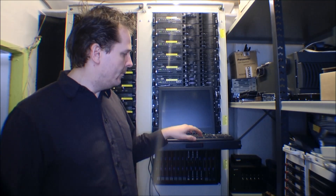Right now I am booting the server and I hit F1 to go into the BIOS. I hope I can find the setting I need to enable. Here we are inside the BIOS — under Advanced Setup, under CPU Options — I think it's this one that I have to enable. Enable. Yes. Escape, escape, save the changes — Save Setup, Enter — and let's exit. We will boot again and see if it boots ESXi 5.5.